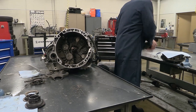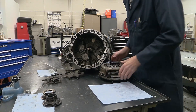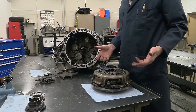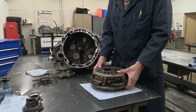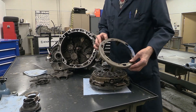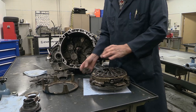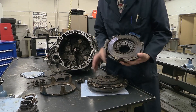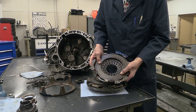Let's take one apart — here's the same dual clutch assembly. You can't take them apart and service them separately; it's all one unit. I had to cut these rivets off — they were tough, but they came off. I'm going to refer to this outer piece as the cover, similar to what a manual clutch assembly has. This next piece is where the two sets of pressure release fingers reside, and these act on this clutch disc and the one underneath. This is essentially what you would call a dual-acting pressure plate.